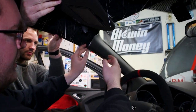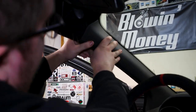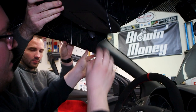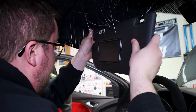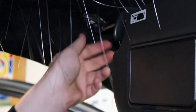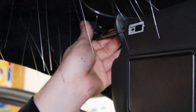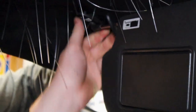Now we can push in the driver side A-pillar here, just the covering. Here all the clicks go. That way it'll kind of help support this. And now Derek can let go of the headliner here. Now, we should be able to get going with this guy here. You notice there's some tabs here that you gotta push through. We just might need to open up the cut a little bit here and get the tabs through just because we laid the new liner. Maybe we'll get lucky.